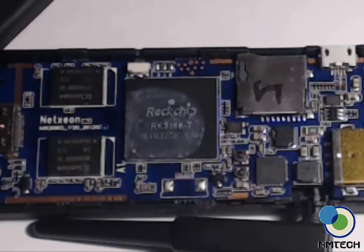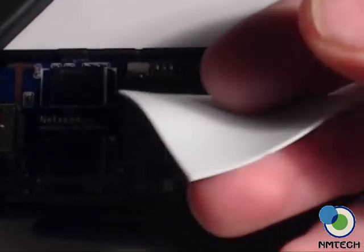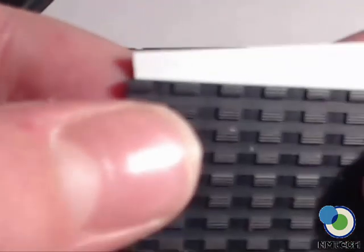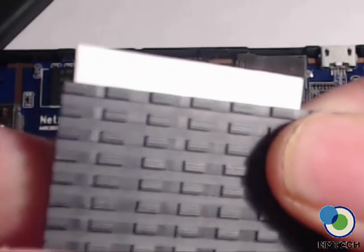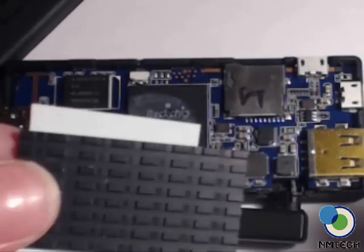So what I'm going to do is take a thermal pad. I got maybe five of these off of eBay for $3 or $4, and it looks like this. It's not adhesive, so it won't stick on its own — but all you need is tape, and I'll show you what we're going to do. Take the thermal pad and place it right under the heat sink, right under here. Just kind of pull it down a little bit — it does kind of stick to it, so it's a bit hard to reposition.